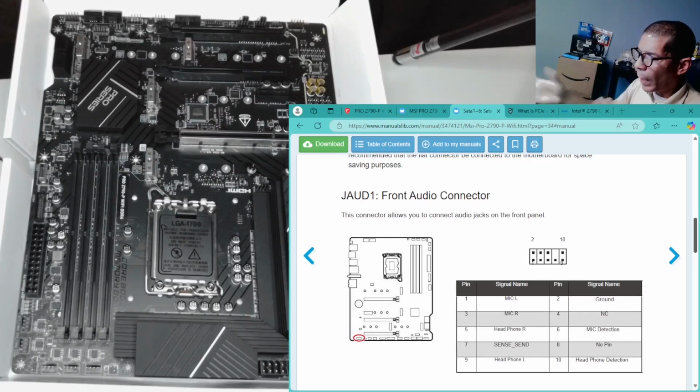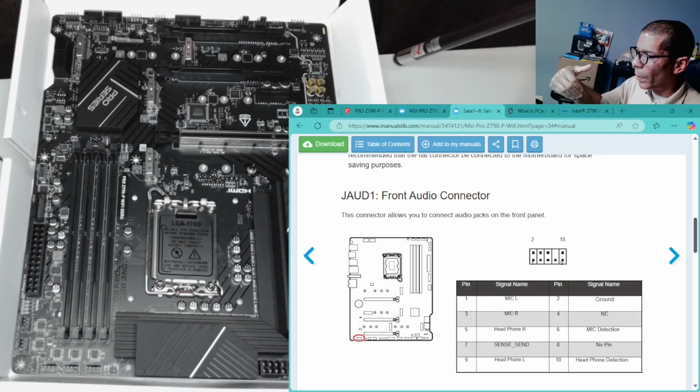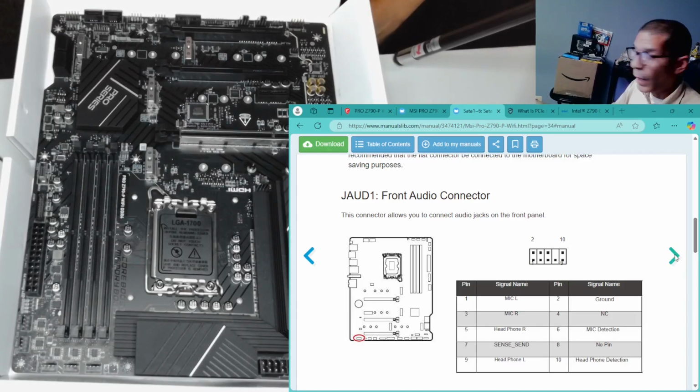So these are the things that you're going to find when the motherboard is inside the case and you have your cables where it's supposed to come out, in addition to the wires that the case has, you have to account for, okay, the case comes with audio jack, or it doesn't come with audio jack, so then this will be unusable. Or like I mentioned before, the USB types, it may have a C or it may have an A, or which version we will have, or may have one of each, or just one. So at that moment, by going through the manuals and all that, you put one and one together and say, oh, okay, now I remember, I do have an audio jack, so that must be this cable that goes in there. So if you remember the location where it's at, then you go ahead and plug in. Otherwise, I recommend 100% to look at the manual.